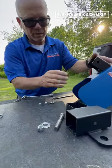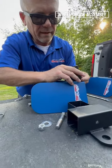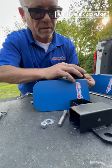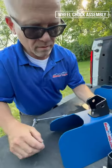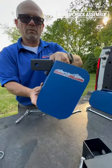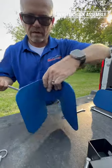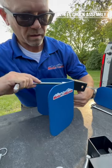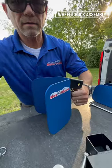The hardest part of this job is getting your fingers up inside the bracket and getting the nuts to thread — sometimes it's easier to spin the bolt from the bottom. I'm going to get these pre-loaded like that. This is the bottom of the chock, this is the top. Now I've got a long extension so I can get out past the chock, and I'm going to hold it in the back and use my quarter-inch drive until it's snug — that's it.